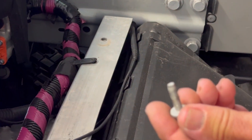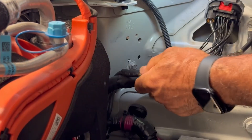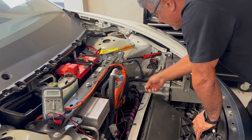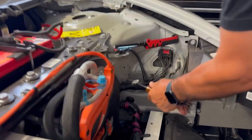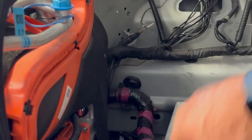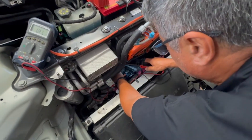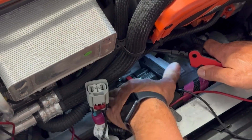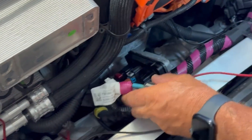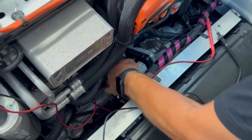You're relying only on the bolt to ground it. See the bolt - the head of the bolt actually hasn't got a great earth. So this wire here - I'm not sure that's providing good ground for both of them. No ground, no ground. The bottom one is the other ground. So the bottom contact - the power supply bottom one here - is the ground for that one. That black wire is the bottom one here. The blue one's power, the black one's your ground.